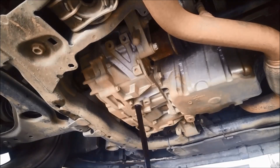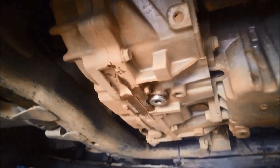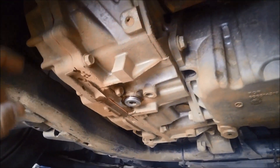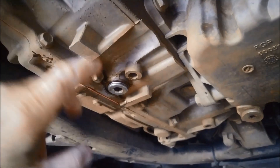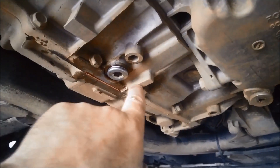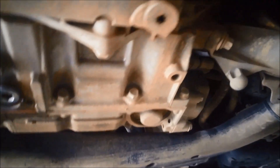The oil is pretty dark — you can see it's pretty black. When you're draining the oil out, because it's got a filler tube or fill plug, it's always a good idea to blow a bit of air through there. You'll get an extra bit of oil coming out and hopefully any muck that's settled in the bottom of the case will come out with it. Just another little hint you can do, and that's basically it — there's not much else we can do on those.